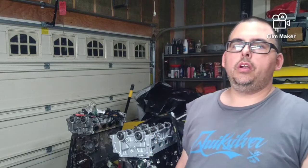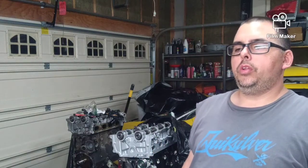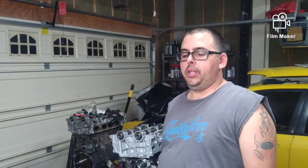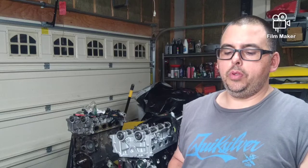Hey guys, welcome back. In the last video you saw we put the main bearing support pan on, we put the cams on, we put the oil pan on. I ate a little crow because I'm not a fan of RTV, but I ended up having to use it on the oil pan. In this segment, we're going to get the cams and cam gears put together.